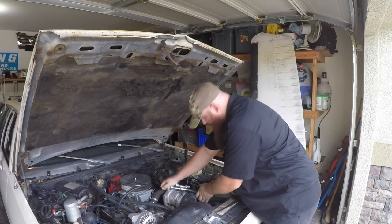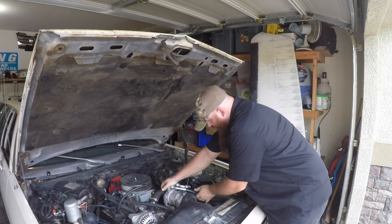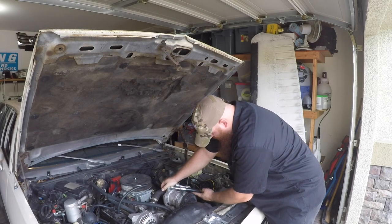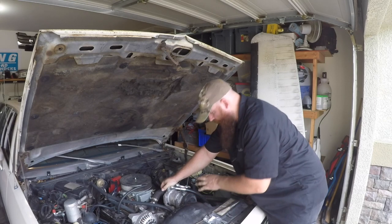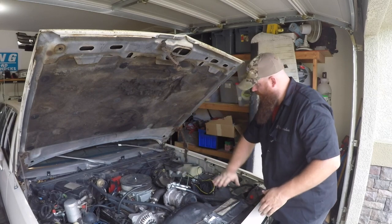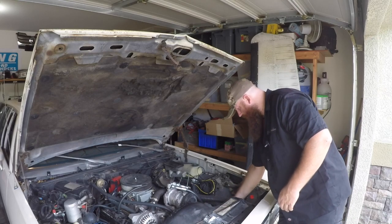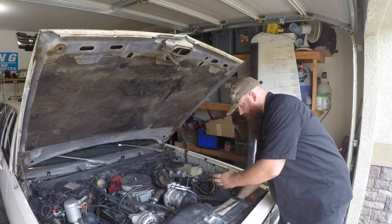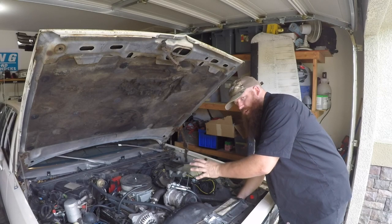And this is applicable if you did an engine swap, which I did, to a different type of AC pump. Now once you get the hose to cooperate and go where you want, make sure that you're not going to be next to anything dangerous, any spinning pieces, and that you have no hood clearance issues, and that when you set it up for the next piece, it allows for the engine to torque.